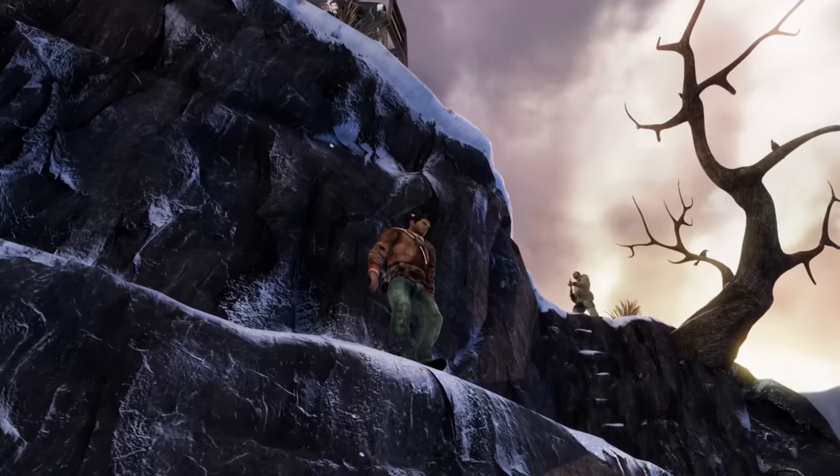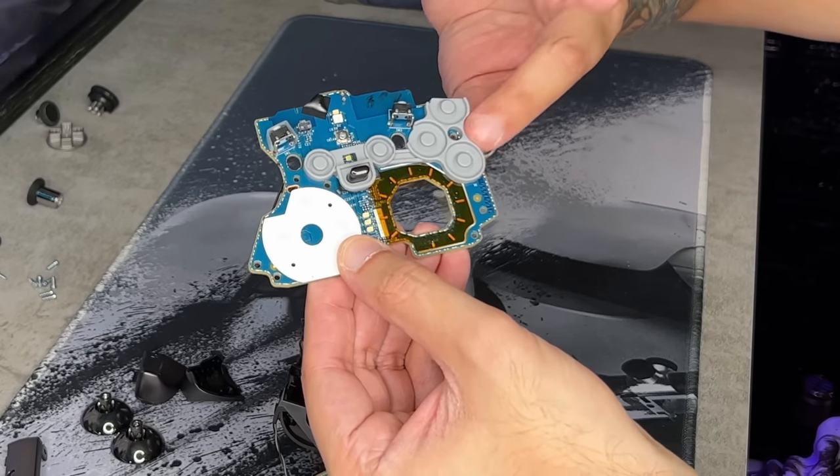As for the D-pad or direction buttons on the Storm, they're not bad but they are different. It's a very smooshy feeling, but I think that is by design, considering roll-offs and diagonal inputs are effortless — it's very fluid to change from all eight directions. However, there is no distinct step for any of the eight gates, and you definitely feel that — not a very secure press. It is almost completely silent, which I do love, and it is raised a few millimeters from the shell, making it very easy to press. I am a fan of this D-pad, although it feels different than what I typically look for, which is a nice tactile mechanical click. But this is a damn good membrane D-pad — there's still a rubber plunger mechanism under here, but in the membrane department it feels very good.